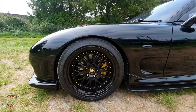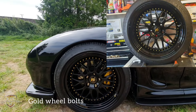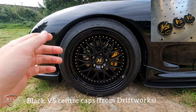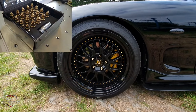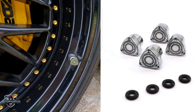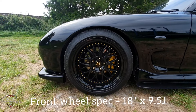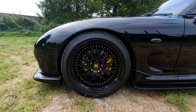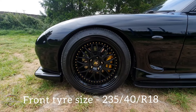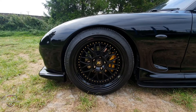While we're on the subject of wheels, these are Work Meister M1s with gold bolts going around the edge. I didn't really like the silver Works centre cap, so I've got these black VS ones — just goes with the theme a bit more. There are bullet-shaped gold wheel nuts in the middle, wheel decals made online, and rotor-shaped dust caps. Front wheel specs are 18x9.5J, offset ET+22, no wheel spacers. Front tyres are 235-40R18, though I will be going down a profile size as they scrub on the wheel arch liner from time to time.